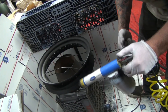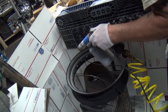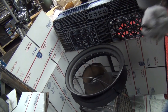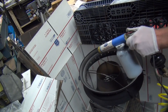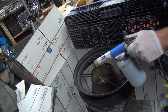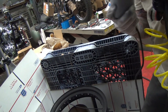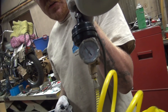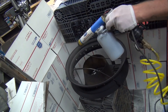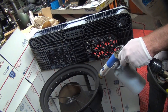Got too much air, not enough powder coming out. Your valve has to be open so my valve will work. Okay, some more pressure on my side now. I hear it blowing but it's not coming out — blowing is not good either because it blows it off the part. I don't think the extra pressure is helping us any. If you hear it blowing you got too much pressure. What's the poundage on the gauge? Like seven or eight. There it goes — starting to come out a little bit. It works good for a bit and then it takes a crap.